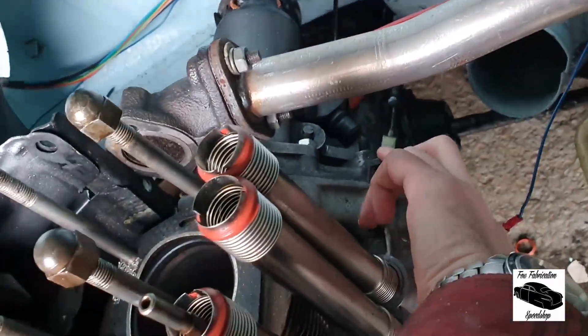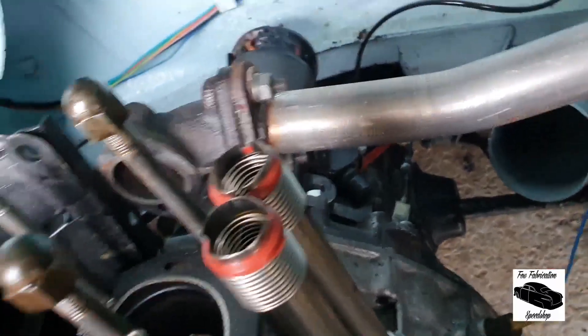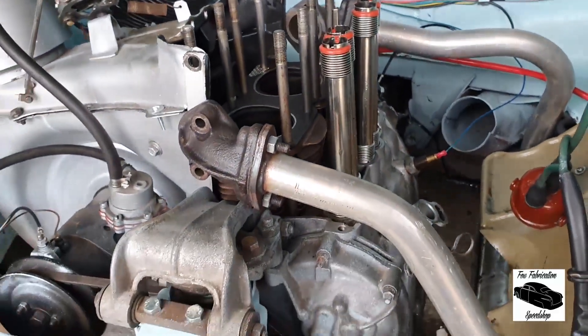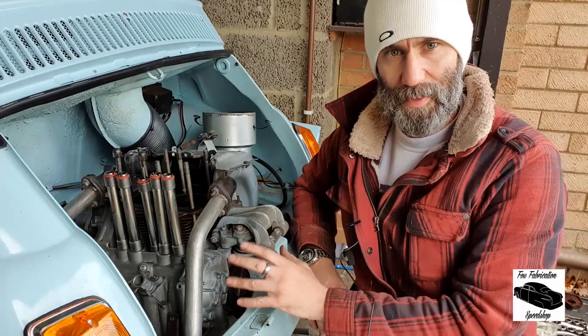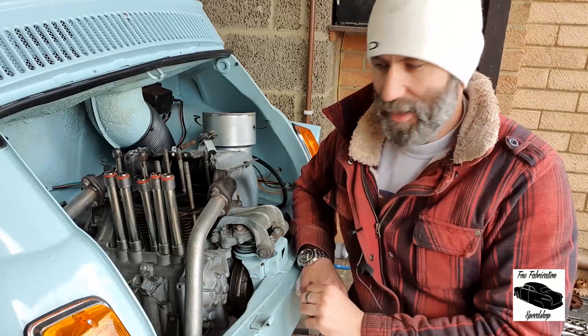What I'll do is split the bell housing, remove the starter motor — remembering to disconnect the live at the battery to avoid shorting anything out — and then we'll put the engine on a transmission jack and lower it down. We've pre-loosened all the bolts, removed everything, and disconnected all the wiring. Fingers crossed we'll see how many 'whoa' moments we have whilst something catches during removal.